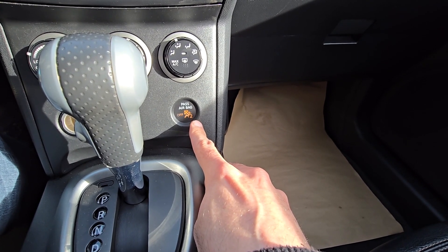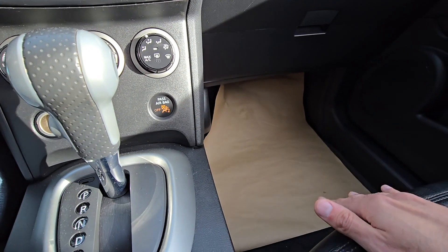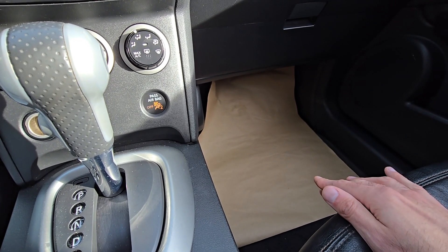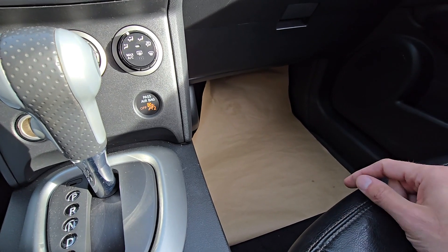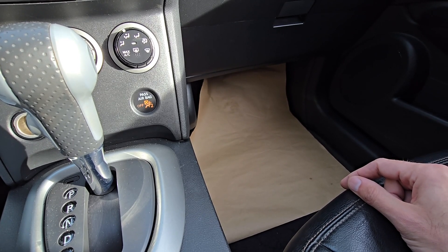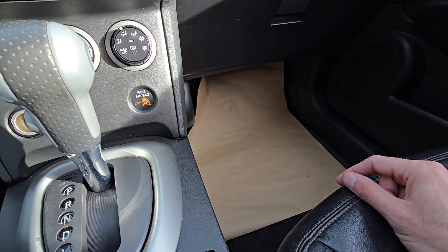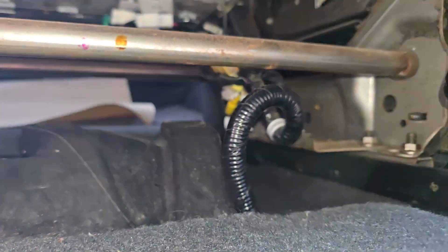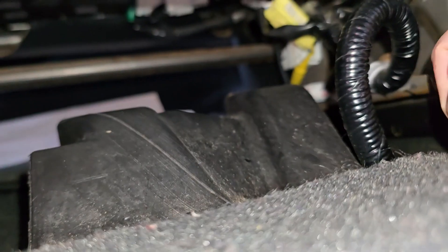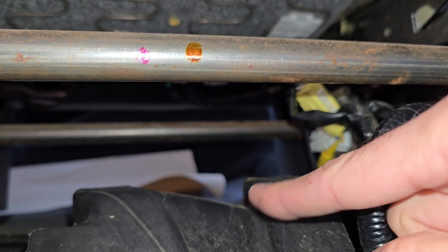This is something you have to fix as soon as possible. In some cases it might be only a wiring problem, so the first step is to get under the seat where you will find a yellow connector. You just want to unplug it, clean the connection, and plug it back in — that can hopefully fix it for you.